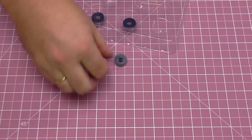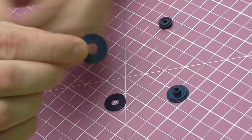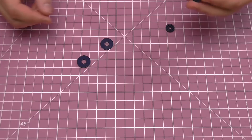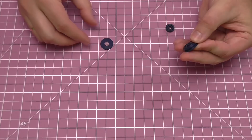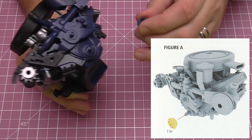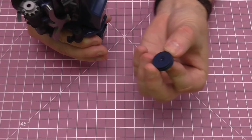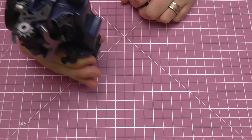All of these pieces are labeled. For example, one says 11k and the pulley says 11u. We take the 11k one, then the 11j one — holding it so all the indents face away — and put that in. Then we put 11l on top with the writing facing towards us. Back at the engine, we've got a spindle and put the pulley base on, which is part 11h. The 11h needs to face down when we put the top part on, with 11l facing down towards the base plate. That sits over the top and is held in with a GM screw.